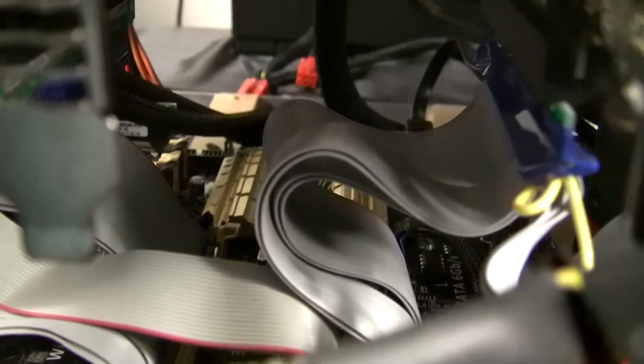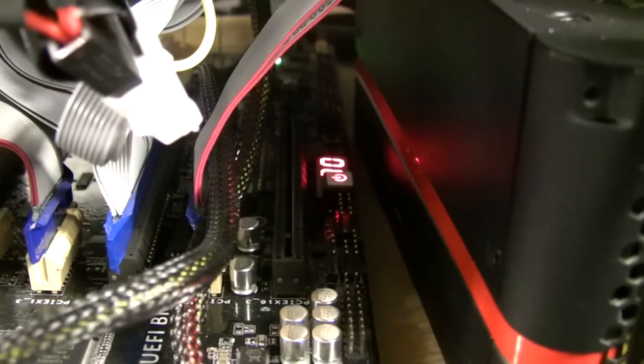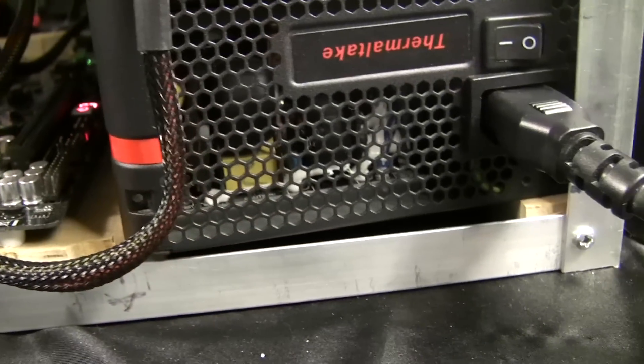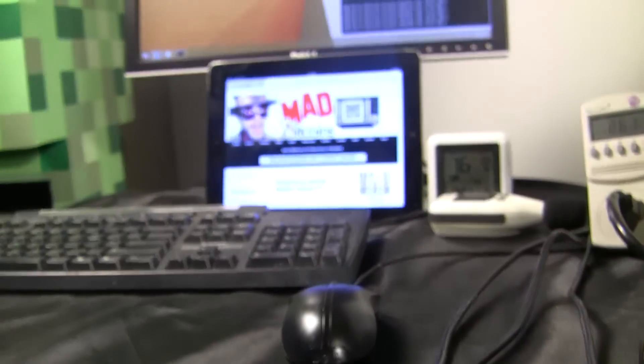In closing for this piece, I want to make sure one thing is clear that I haven't covered: it's not always about the wattage on that power supply. It's also the 12-volt rails that connect to your graphics card. Check the manufacturer specs on the graphics card you're choosing and make sure whatever power supply you're choosing — especially the second one — supports the rail requirement.